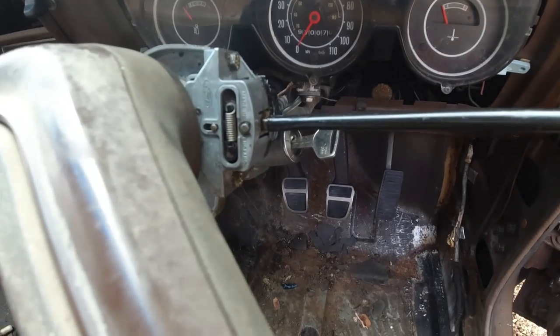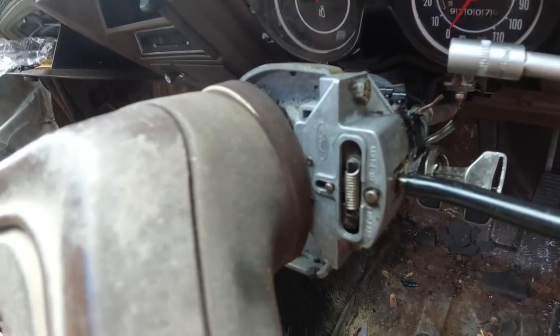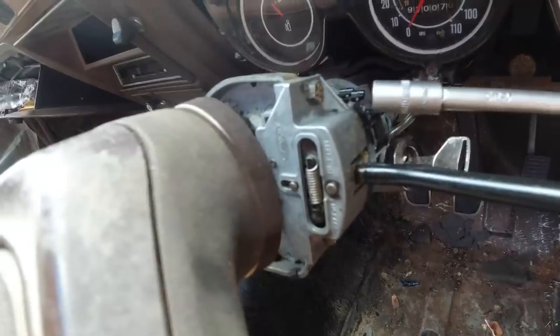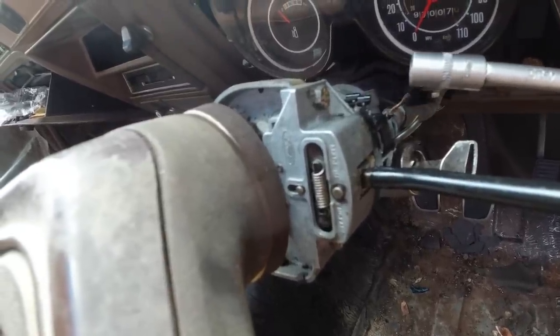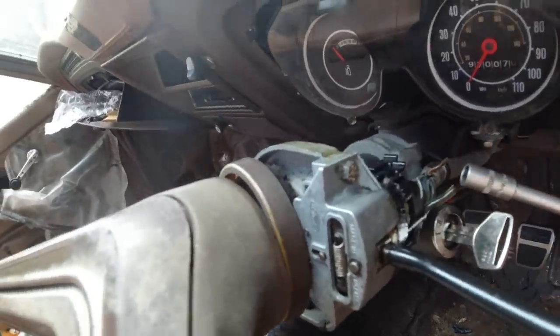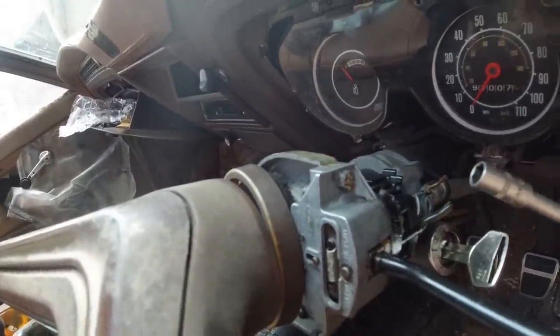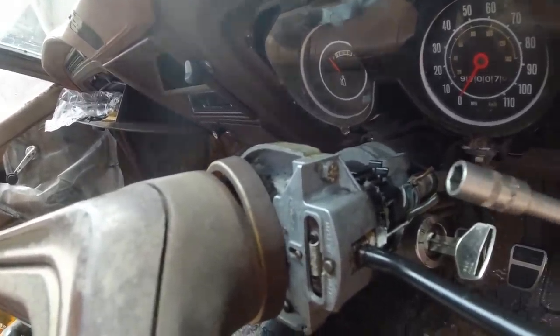It's all gone back together nicely. I've done a combination of super glue, then in the rivet heads I've put two-part epoxy. It feels tight. We are at an advantage in that the wiring plug at the back is pushing up against it, so it's actually never going to strain.